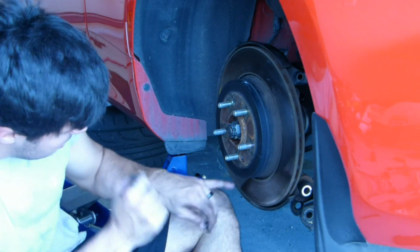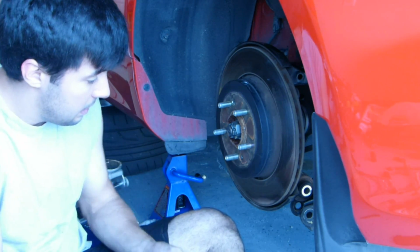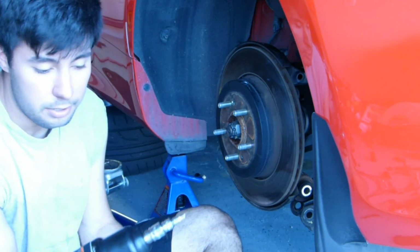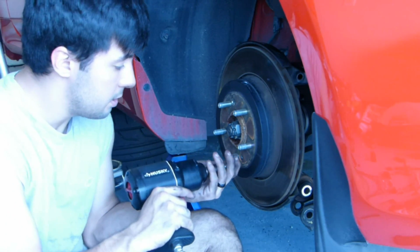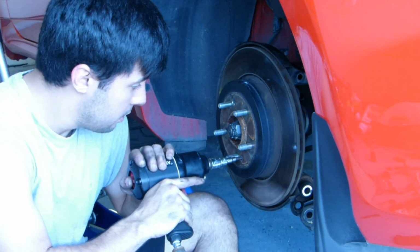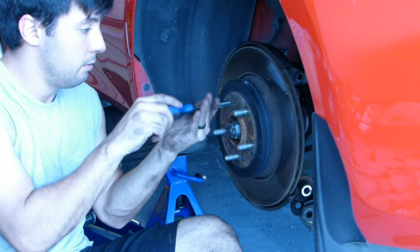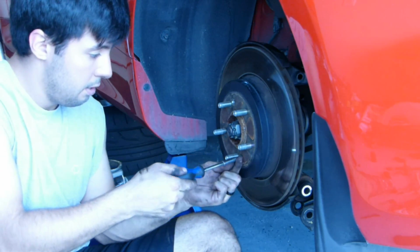Now this happened to me before on these where I went to turn it with the hand screwdriver and it pretty much just went to strip it out no matter how much I pushed in. So what you can do, turn the pressure down to like 20 psi, something really small, or if you have a really tiny one of these that doesn't have as much oomph to it, press it in pretty hard, just give it a light tap, and then it's loose. And you can take both of them off. Top, and of course bottom.